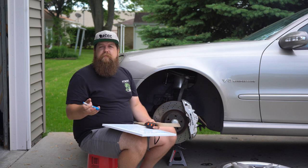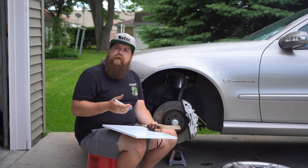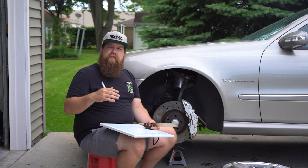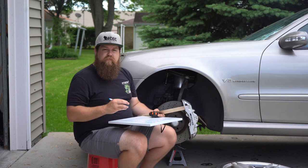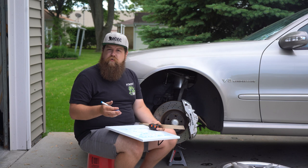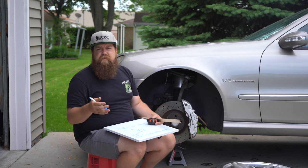So now that we have our basic measurements up front, we know we need at least a 17-inch diameter wheel with a spoke backspacing of at least 41 millimeters to be safe — although most aftermarket wheels are designed with this in mind and it's probably not going to be an issue. But you're better off knowing now so you can reference with your wheel company of choice, rather than ending up with something that doesn't fit and having to ship wheels back and forth.